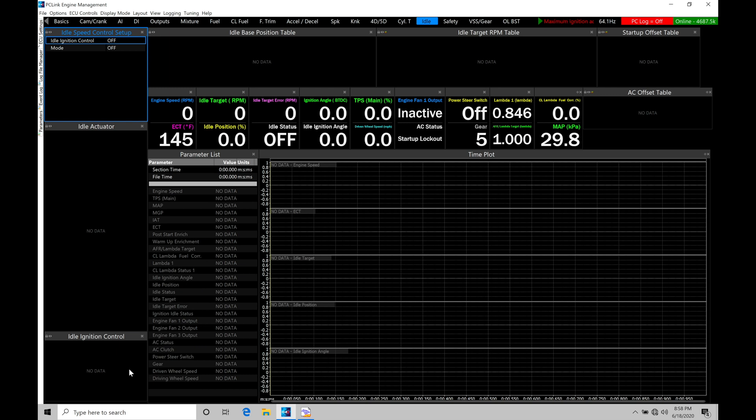What we're trying to accomplish here before we jump in and start programming is to regulate the idle torque. The idle torque is going to get us to our desired idle speed. Engines will typically idle anywhere between 6 to 10 pound-feet of torque at idle, and in that range it's going to hit our desired idle RPM. So we'll find whatever our actual engine RPM is and compare it to whatever the target is.